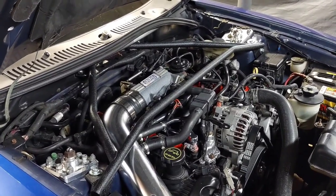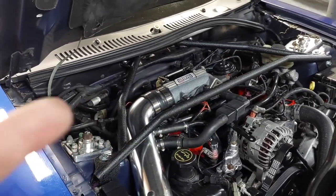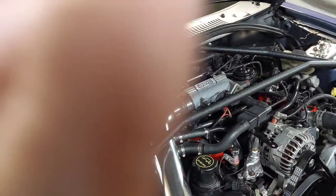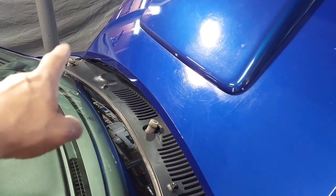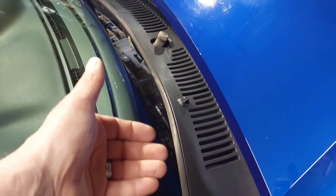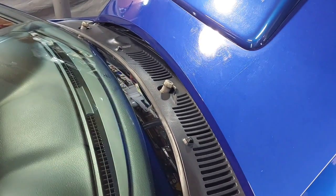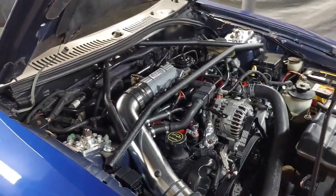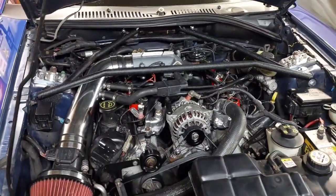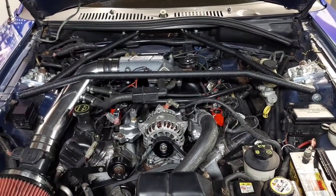For all the work involved with installing the strut tower brace, it was a bit of a challenge, and I broke the cowl. If you are not careful with that cowl, it is a bitch to get out because it's got a bunch of clips along here — I think there are five clips. You gotta shove one of those molding tools underneath it and pop it up, and you also have to disconnect the washer line for your windshield washers to take the cowl out of the way. But in the long scheme of things, you can see what it looks like. For anyone who has questions, just shoot me a comment and I'll do my best — this is what I did.